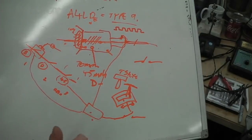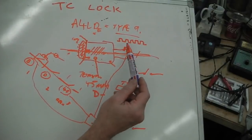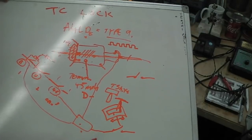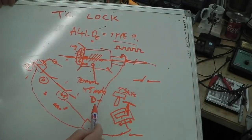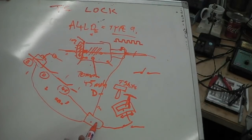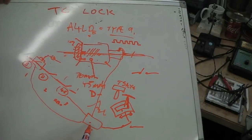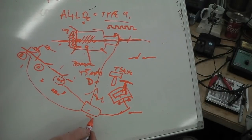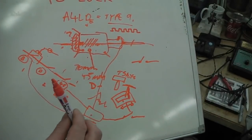But not only that, it must also have a facility so that if the sensor gives any spurious information, or fails or goes crazy, or you get interference or any kind of electrical problem, for example if the alternator went haywire, you don't want to falsely trigger this. I have seen it where you can get electrical spikes, a quick spike that can fool this into thinking it's doing 70 mile an hour or whatever. Well, we build a second level of hysteresis in, where it has to be constantly happy with a smooth signal for a measured amount of time.